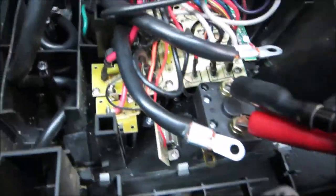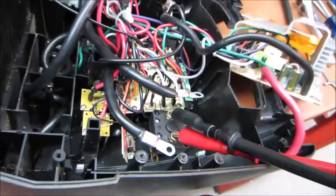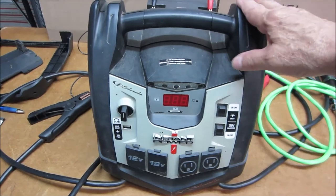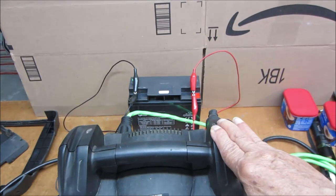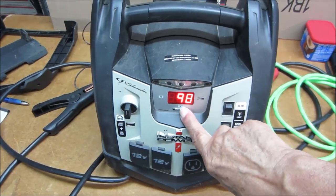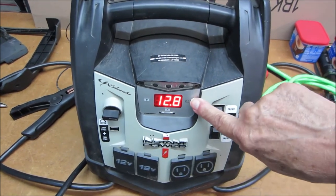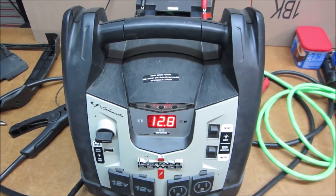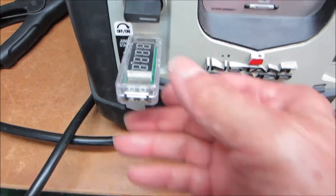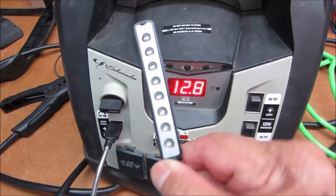She's back in now — probably wise to make another test. We've got it all back together. We do have a display now indicating that the battery is up to 12.8 volts. Unfortunately, what we don't have is any power at the USB — the USB is dead. I'll put in a test light — might be easier to prove. See, this does not turn on.